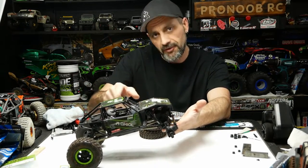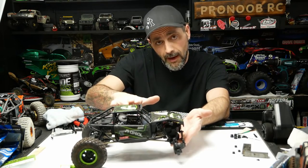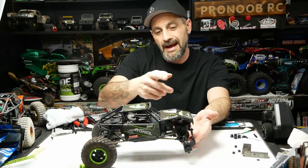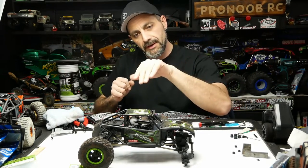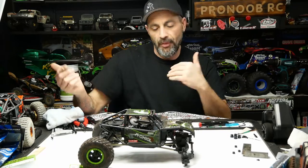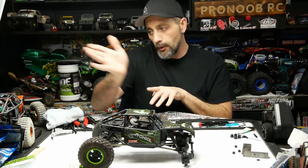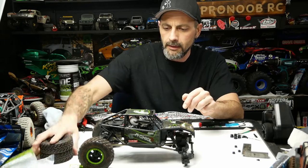Now the front axle will turn quicker than the rear, which is gonna help pull your body down as it's dragging the suspension out, and it's gonna make your front axle a little bit quicker, so he's gonna be deciding where you go instead of having both spinning at the same speed and you're kind of trying to work around both axles at the same time. You want to turn over here, but the back axle wants to go straight over here. Now you can go that way and carry the back axle kind of drag along with you. Simplest way to explain it.